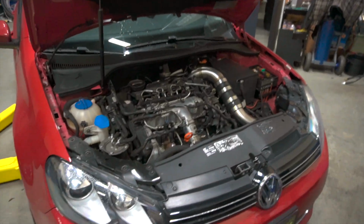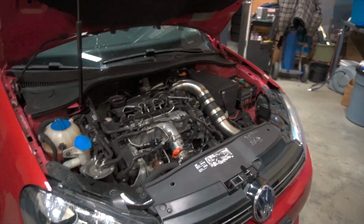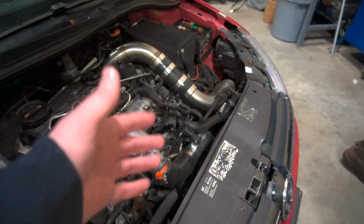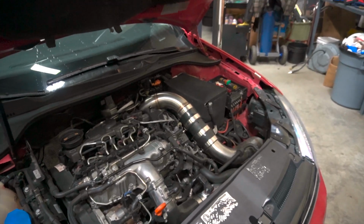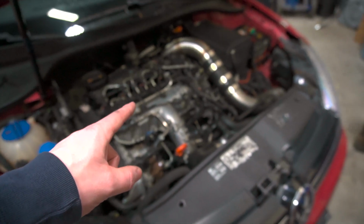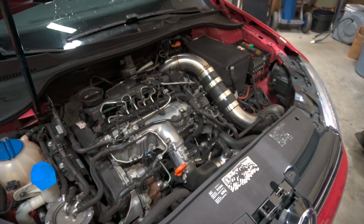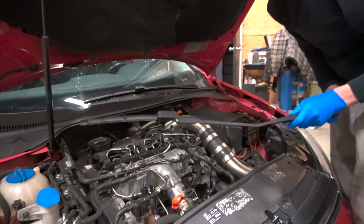I've gone over all the boost piping and everything and it does not seem to be a leak. Intercooler is fine. I resealed the map sensor for our custom intercooler piping and that doesn't seem to be the issue. But I did take a quick look at the impeller and it does look like they are all damaged. So, and I'll put the photo here, but they've been off so many times we don't even need to remove them. Oh, there you go.